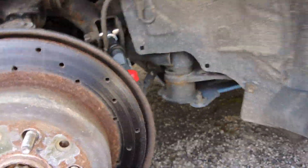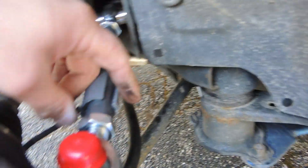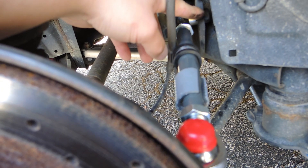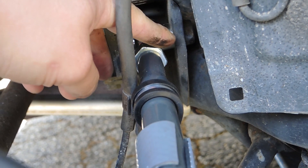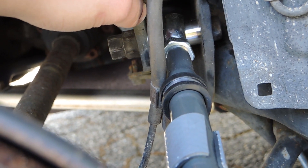What I did was I replaced it with FIG Engineering's version which is adjustable. And this is the part I was going to talk about — these two pieces of metal right here, they're stamped steel. Over time, when people do alignments, these things get deformed really badly and then that screws up your adjustments even more.